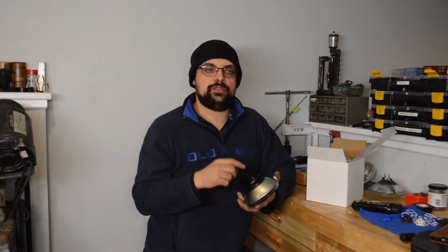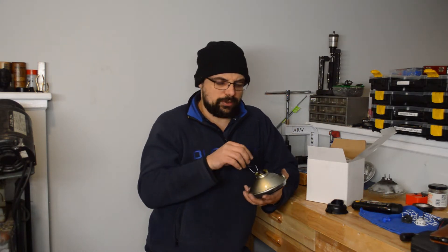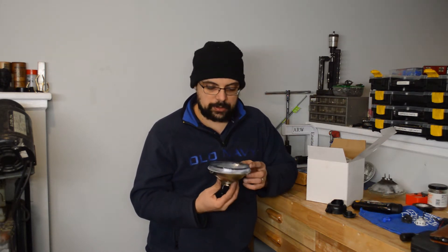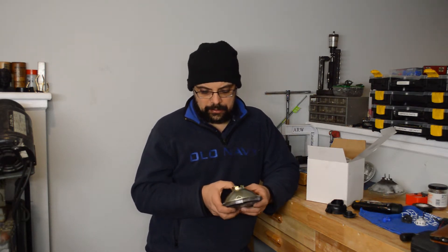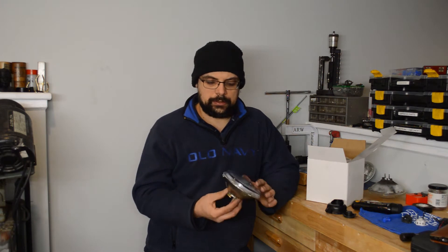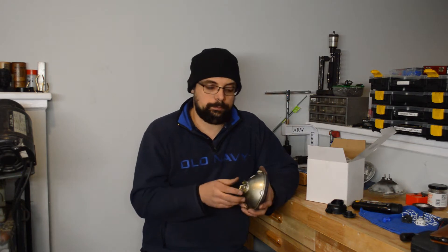One of the more popular things that people do is upgrade their buckets and put these converter beams — from Hella or whatever — put them in their cars, then run an H4 bulb. The beautiful thing is the car is already basically wired for H4. This is what the bucket looks like — it's actually a metal bucket, the chrome looks pretty nice, and it's glass. I found these on Amazon and they were surprisingly cheap — I think they were like 20-something dollars for two, so it's basically less than 50 bucks to do all four headlights.